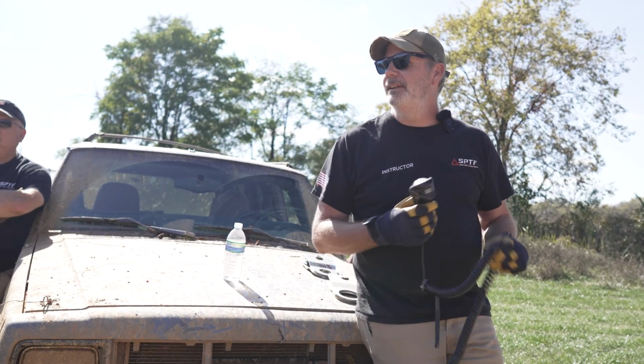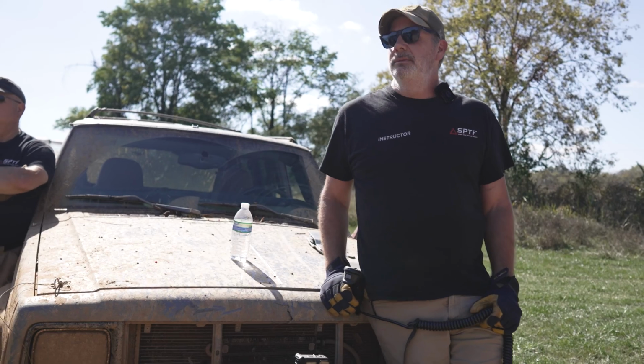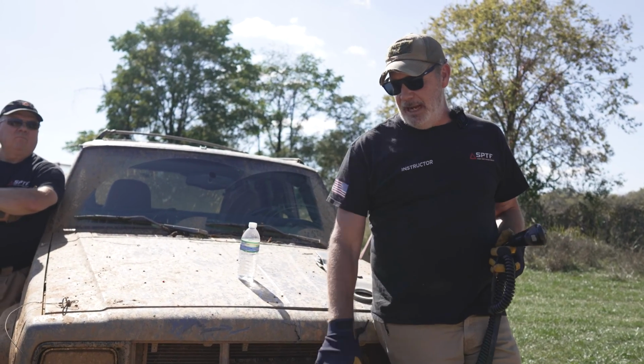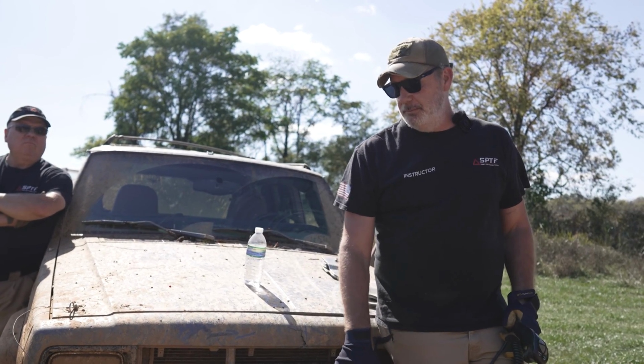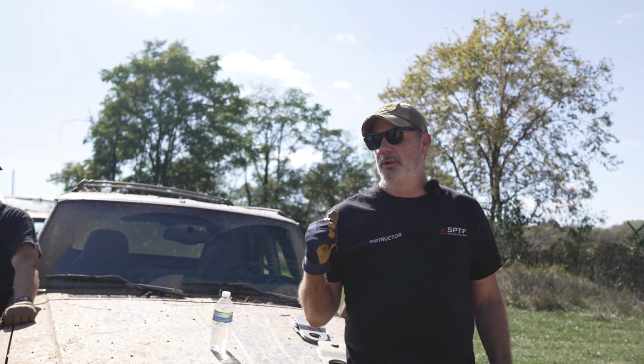What am I forgetting? Yeah. This car is static and you're trying to pull something else out. Would you want to try to put this one in gear and then shut it off, or just leave it apart? So if you mean I'm recovering somebody with this, right? Nope. Always, if this winch is operating, it's got to be on. And there should be somebody behind the steering wheel of that vehicle. So always be in control.